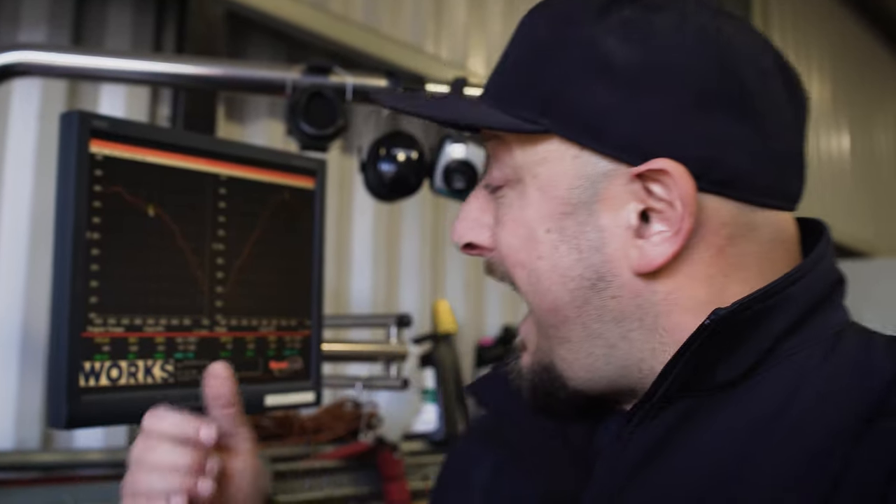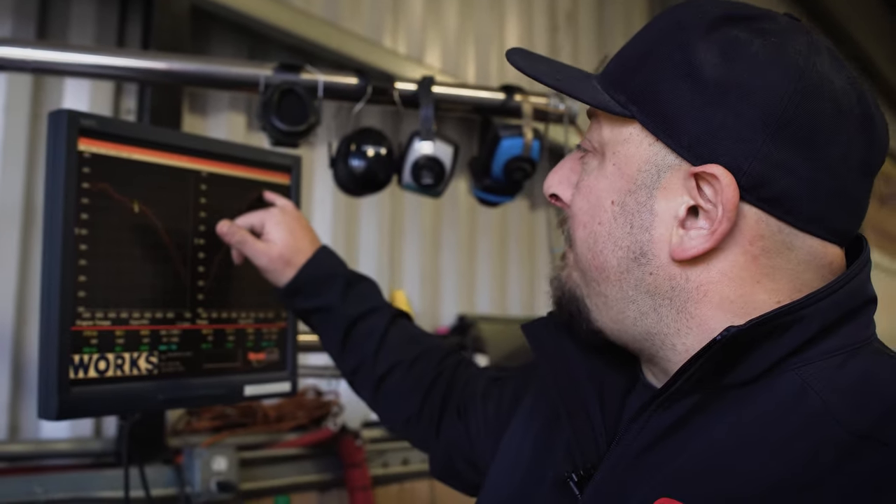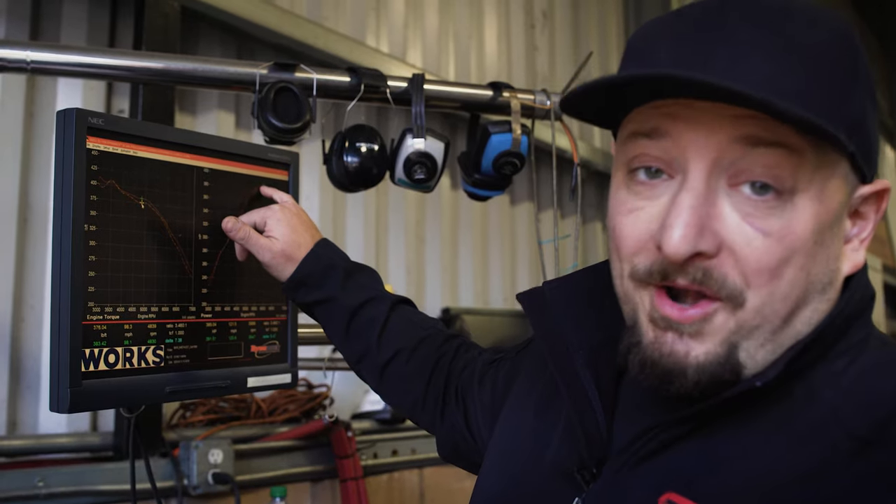Now that's pretty crazy. We made 391 horsepower, which is a gain of 6 horsepower. And we actually made 7 feet pounds of torque as well, which is wild for just changing the oil. And if you look at it, our peak power was better. But after peak, the power band got better too — which is pretty wild for just changing the oil.